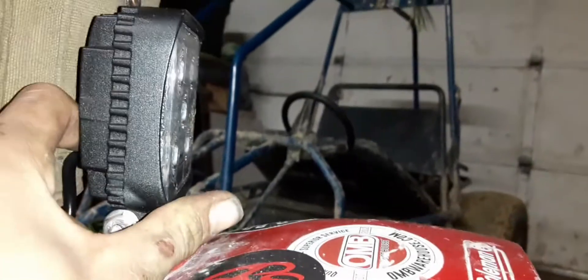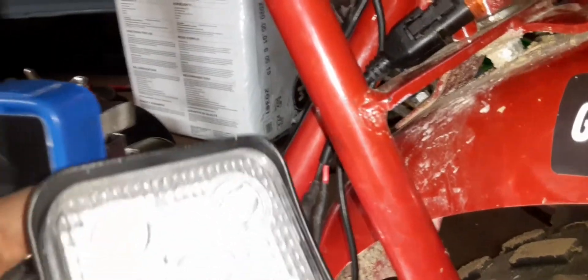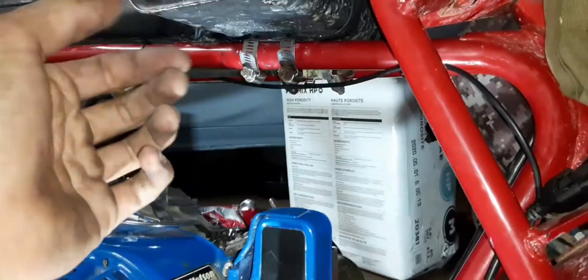If I need to aim the light down a little bit more — it's currently lighting up the fender rather than going where I want — I'll add an inch of washers or a small spacer in between so I can get the clearance I need to aim it properly. The cool thing is I don't have to make the other side of the connector because I already have the old plug with longer wires soldered into it. My rear light hot wire is still connected since the rear lights were working fine — it was just the front one and part of the charging system that were the problem.